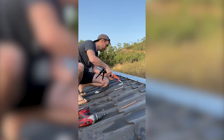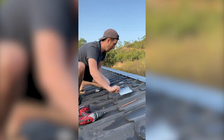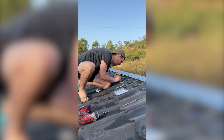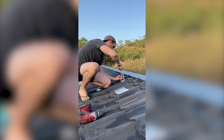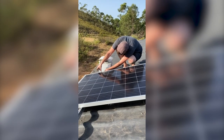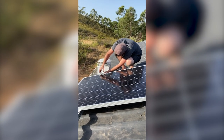Once you've got your solar panels, you need to mount them to the roof. We bought a kit with our solar panels that had rails that snapped straight together and mounting brackets to mount them directly to our roof. We have an aluminium roof with wooden beams underneath, so we used some silicone, some mounting tape, and the brackets on top to mount directly into the wooden roof joists of the caravan. That's made a really secure seal and there's no way that water can get in.